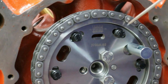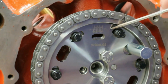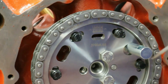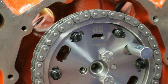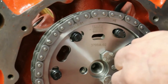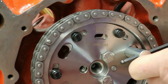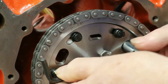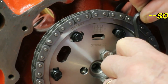What we are looking at here is the Comp Cams adjustable cam gear. You should be able to just see some timing marks here, and by loosening these bolts we're able to separate the chain wheel part of the gear from the center part. With this special tool here, we can insert that in and alter the cam timing one way or the other. Nobody should be testing cams without the aid of one of these, or something similar like the Jesel belt drive.